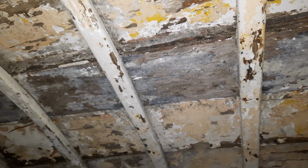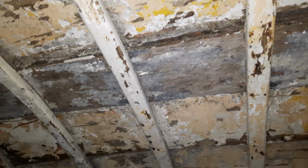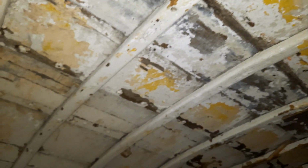Generally with stuff like that, with smaller cracks like that you won't get putty into anyway, or not very much. You've got to tape up underneath. And in order to do that, it's got to be clean enough for the tape to stick. So I think I'll get the wire wheel in here. Just do where I can see daylight. I'd like to be able to show you the daylight, but the camera's going to spoil it.